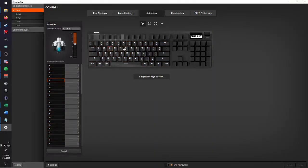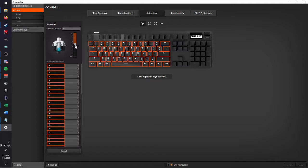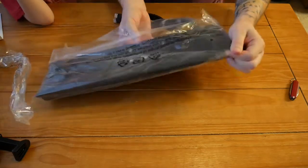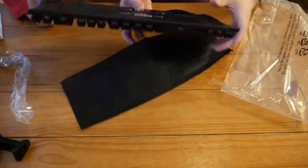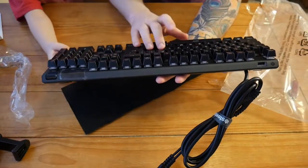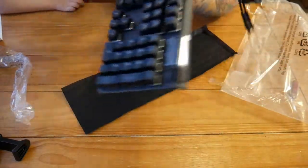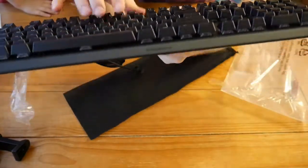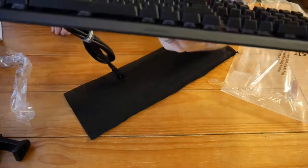One of the best parts of the Apex Pro is the key actuation. Touted as the first keyboard able to do so, the SteelSeries Apex Pro can change its keys' depth actuation settings for the entire board or even each key individually, making it perfect for light and heavy-handed players alike — between 3.6 millimeters and a crazy 0.4 millimeter activation point where the keys will almost activate just by blowing on them. It achieves this by using magnetic sensors instead of actual buttons at the base of the keys, so when adjusting actuation you're deciding how much magnetic force the sensor needs to actuate the key.